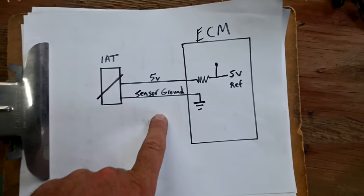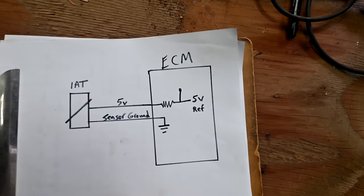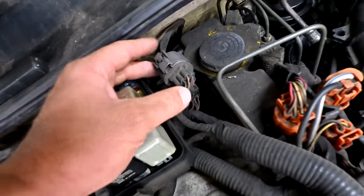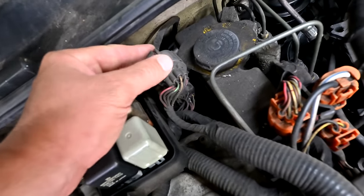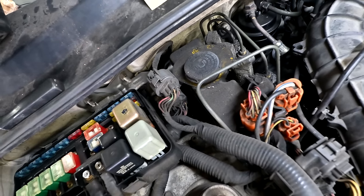Also, while looking at electrical diagrams, sometimes you see a resistor inside your engine control module or your PCM, but also why when you back probe a connector and you expect 5 volts — it's 5 volts when connected or plugged in, but when you unplug it, it's 12 volts.